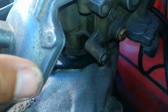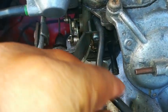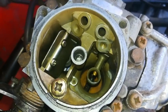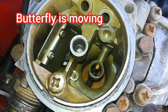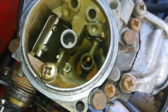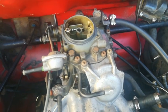This component can be removed quite easily — it's just two bolts, comes off here, and it unhinges the lever further down. The obvious thing to also check is this actual short pipe here: take this pipe off and check if there are no tears or holes in it, because if there's a rupture or tear in here you're also going to have a case of no vacuum. Just to give you a shot of the butterfly that actually moves when the vacuum comes into play — this is what actually happens inside. You can actually see the butterfly moving. Also do a check on the butterfly itself if it's not sticky, and spray some carb cleaner down here.